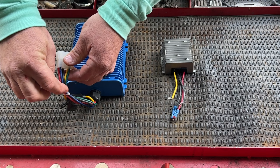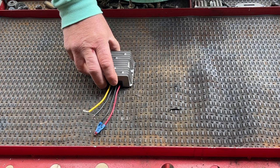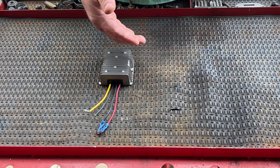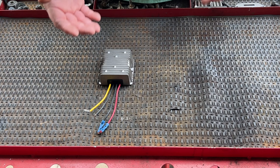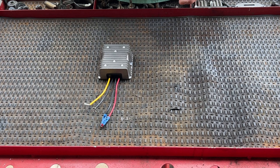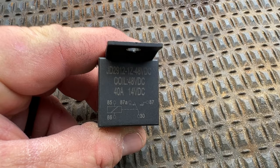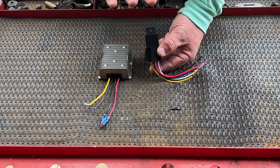This blue wire will stay on even when the converter is off, allowing power into your radio to keep memory functions. Right now the DC to DC converter already in the golf cart is still running, still converting 48 volts to 12 volts even though the golf cart is off. If you have range anxiety, you can eliminate that by introducing a relay. This is a 48-volt relay coil — it looks just like a 12-volt 30-amp relay, but this one has a 48-volt coil.